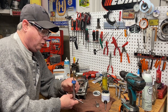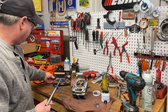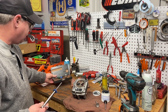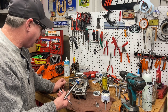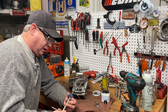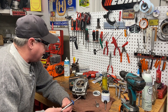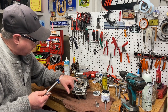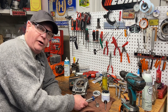I just got home about an hour ago and the valve seat cutting tool kit I ordered off Amazon was here. It was only around $75 — a real good one is like five or six hundred, the Neway type — but I thought I'd order this and try it out. Here's my 45-degree angle seat cutter, and I gave it a couple of turns. To me it looks pretty decent.